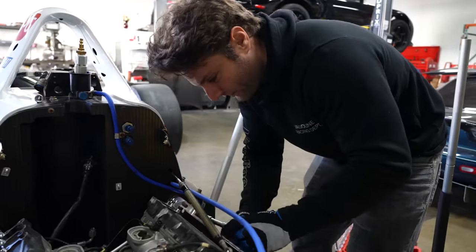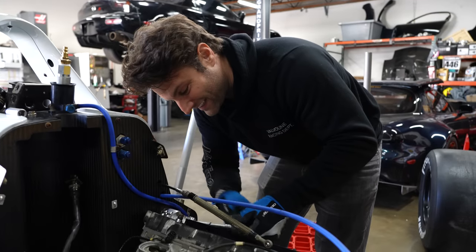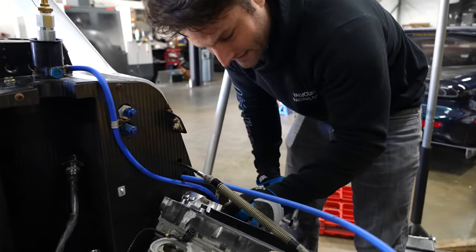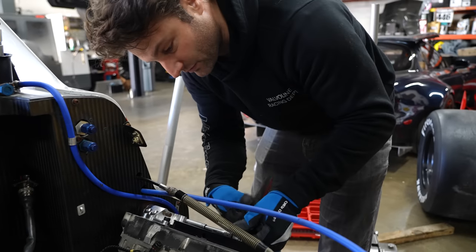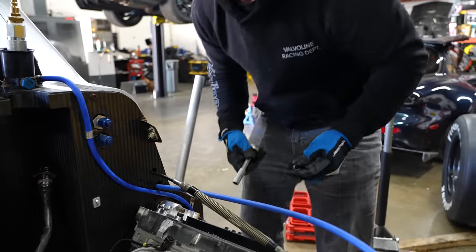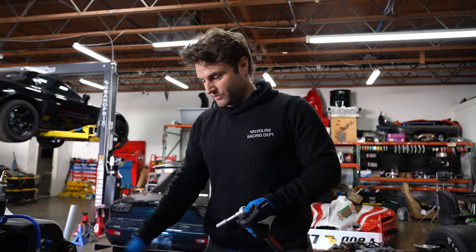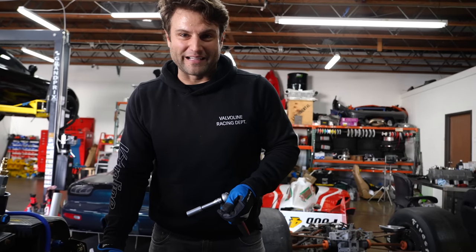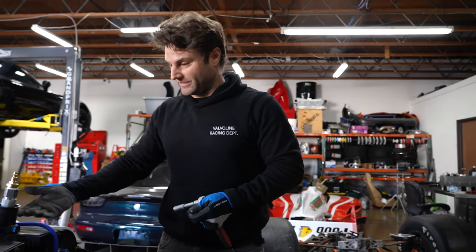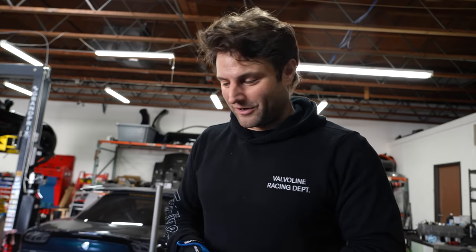These are actually remnants from the four motor's rear suspension. For some of you longer-time fans, you will know that that is 7075 aluminum — so this metal is meant for this. I overbuilt them, and if you look at the pictures you'll see that I added extra material. For the handful of you guys that said that's not going to work, sure. And there was one guy that said you added extra material but that's supposed to break off — that a couple extra ounces of aluminum aren't going to make these that much stronger so that magically the chassis breaks instead of that. Sure enough, there are a lot of people in the comments that have been beyond helpful — a lot of people that work on race teams that have secretly reached out and been giving me great guidance. I very much appreciate that.